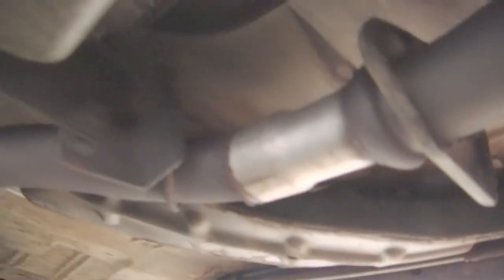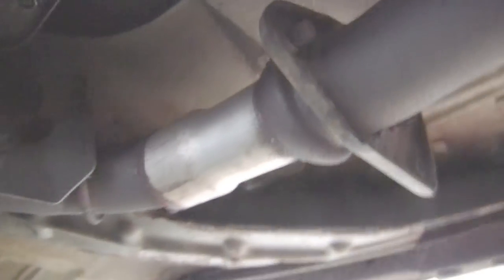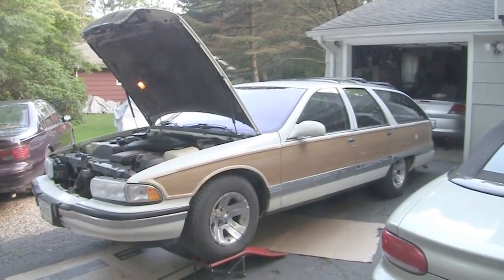On the passenger side floor you can see there are some holes in it, probably from a water leak - possibly the air conditioning drain, which is notorious on these cars for wetting the carpet and ruining everything. And some jerk welded the flange over here where it probably broke, which is going to make it difficult to get the transmission crossmember out - we're gonna have to cut it and re-weld it. Otherwise, the rad support is really clean, a lot less rusty than my '94 ever was. Somebody tried to tow it by the rad support though - the bumper covers are all popped out and the radiator is mangled, although it's not leaking.